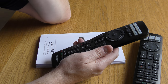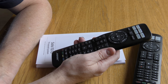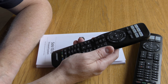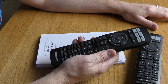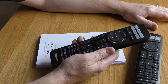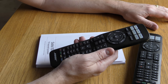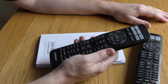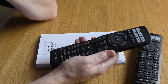There was an issue I haven't got to the bottom of yet: I lifted the TV off the wall mount and checked the connections but unfortunately there was only an analog left and right phono output. We fitted the cables and lifted it back, but the Bose does not recognize a signal from it. I'm going to test with headphones to determine whether sound is actually coming out of the TV's audio out, to establish if it's the Bose or the TV at fault. For now I've used the coaxial output on the Sky HD box going straight into the Bose — no sync issues at all. The Sony processes quickly, so there are no sync problems, and I'm quite happy using the coaxial out.